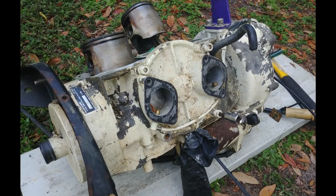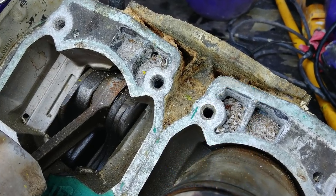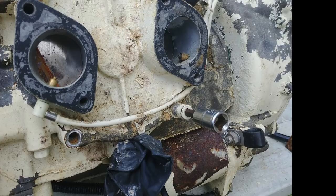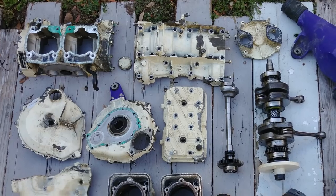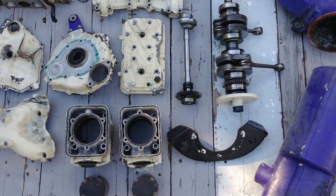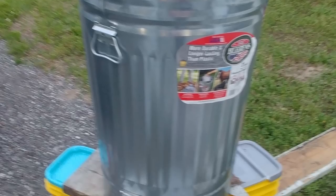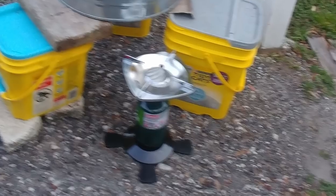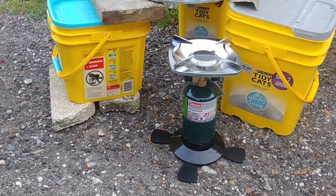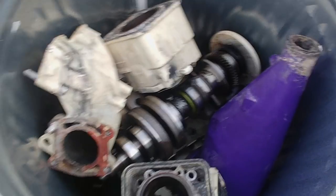Another process that I have started to work on is cleaning up the 787 Rotax engine. As you guys saw earlier, it was pretty dirty when it came out of the ski. I started by disassembling the engine and getting everything completely down to its bare cast aluminum pieces, sorting out all the tidbits and making sure I took photos of everything along the way so I wouldn't forget how to put it all back together. After that I put all of the parts into a metal garbage can that I had sealed with silicone to make sure it would not leak, filled it up with a mixture of water and Simple Green, and put a camping burner underneath it and let it sit for several hours. This heats up the solution and helps get a lot of the grime and nastiness off of the engine. Now that I have this process complete and finished wire brushing everything, I can start putting the engine back together and get it back in the boat.